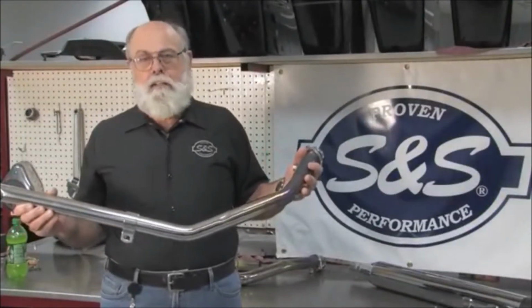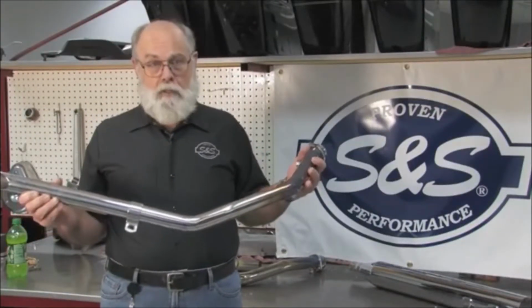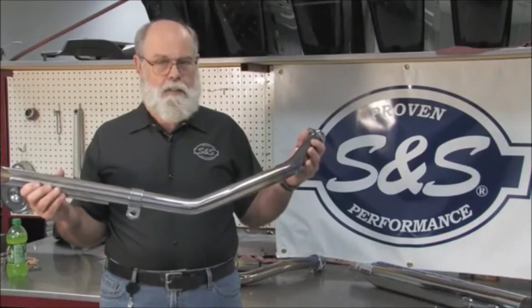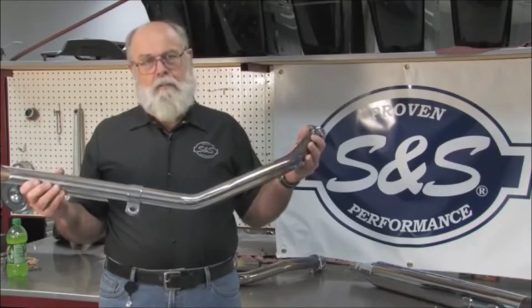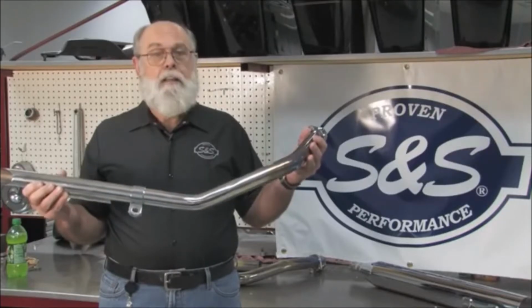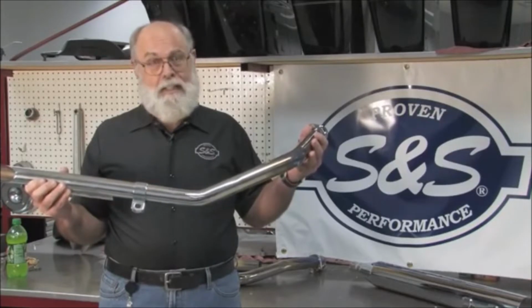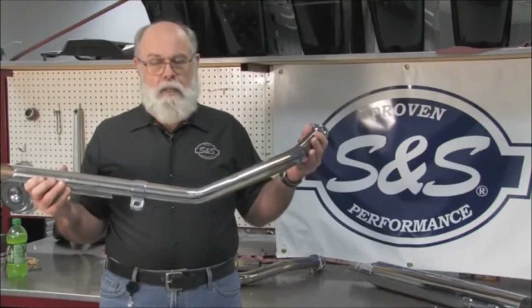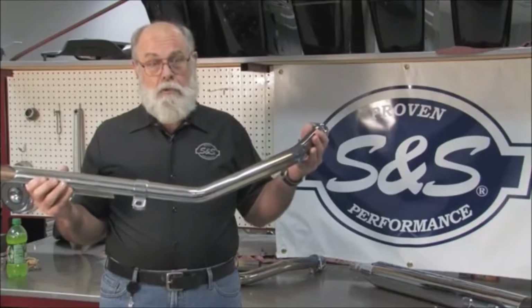If you're running your bike on the drag strip, drag pipes might be a good choice. They make really good high RPM power, but they're really not the hot ticket on the street. Aside from the objections possibly raised by your neighbors or the local constabulary vis-a-vis excessive exhaust noise, etc., drag pipes typically don't perform well in the mid RPM range, where you do the majority of your street riding.